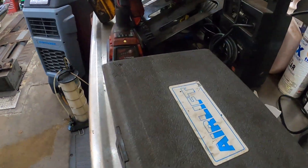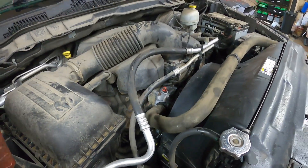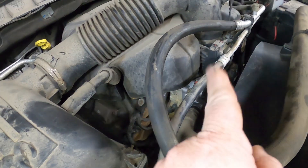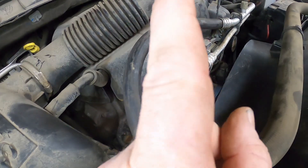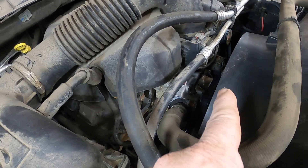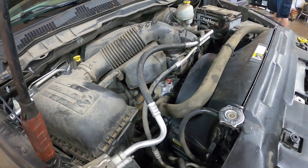I used my airlift to be sure the coolant is full. I torqued all the bolts to 24 newton meters in a criss-cross pass. The only bolt that's not a 13 millimeter is a 15 millimeter underneath that stud — that's the only one. But there are all different sizes of bolts on that water pump, so don't get them mixed up.